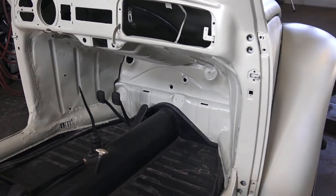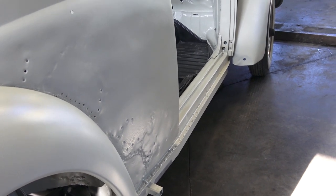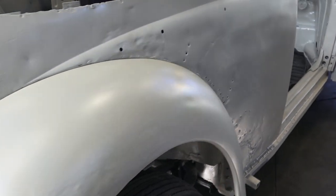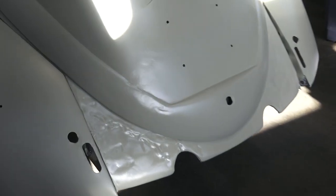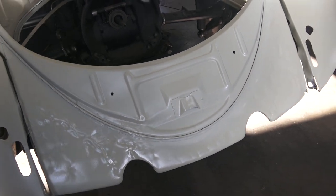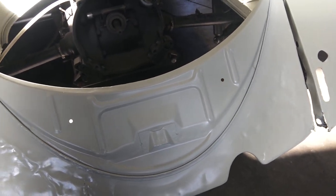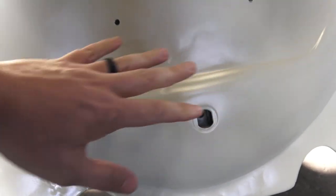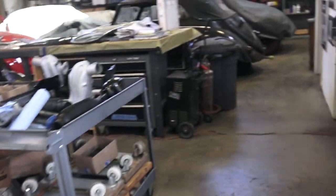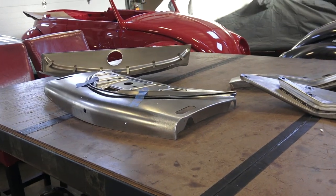We're not going to use a lot of plastic to fill these spots, which is what a lot of people did back then. These were cars that were not of much value back then — everyone was on a tight budget, they were economical cars, so why throw a lot of money into something that wasn't going to bring a big return. Now that these are collectible, things have changed. This apron here — I'll lift up the deck lid — you see how rippled it is. In the past it's been difficult to get a period-correct apron like this classic H apron for the rear. A lot of aftermarket sheet metal parts just don't look right — they're very generic, not year-specific, so you were forced to be creative.